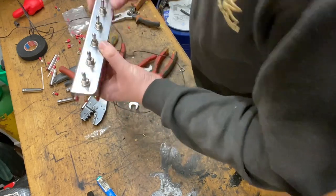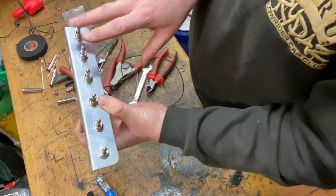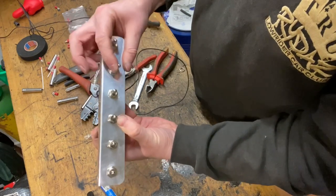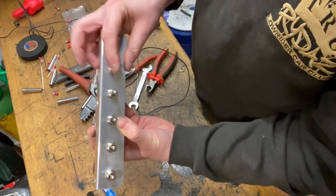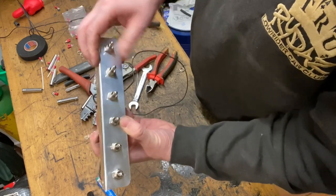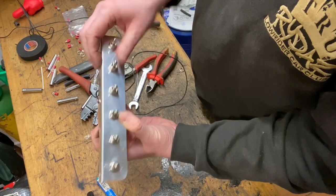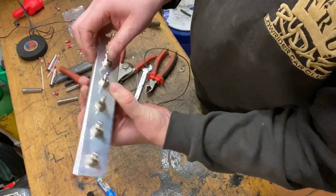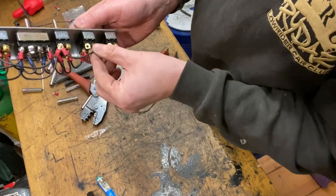We also want this one to dump the front left, because this is going to be the four individual dump controls. Front left, front right, rear left, rear right. So they're going to be like your three wheel switches when you dump one rear corner. And that's just so you can control the front dumps too if you need to level a car out. So if that's going to be the front left dump, that needs to go to this terminal.